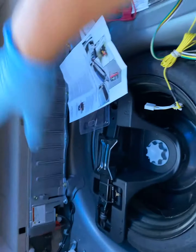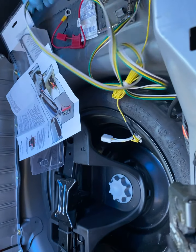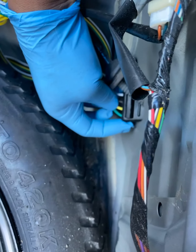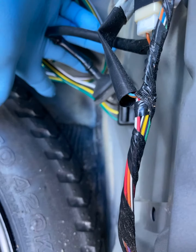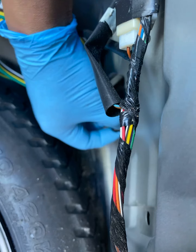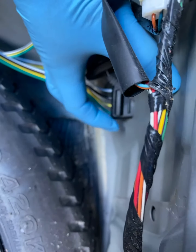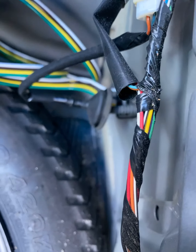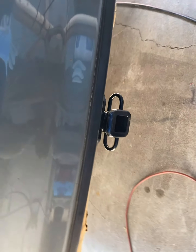After that, run this yellow one to the driver's side. Take this cover off — pretty much take this whole thing off. To run this outside, pull this plug out and push this in here. You can either grind the plastic so it's smaller, cut the wire and reconnect it, or push both sides to make it fit. Then put the grommet back, tie wrap it somewhere in here, and you're good. Thanks for watching.